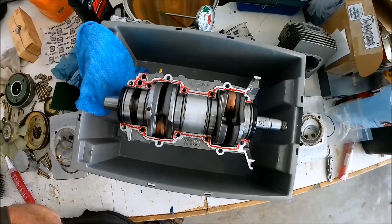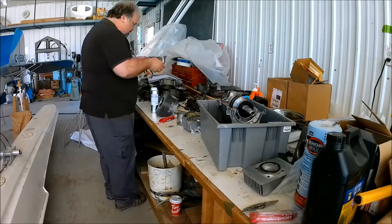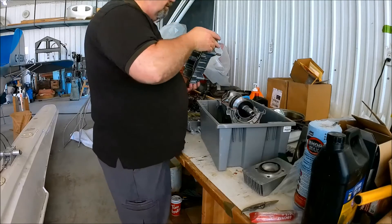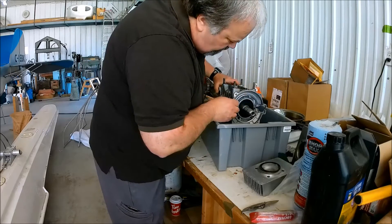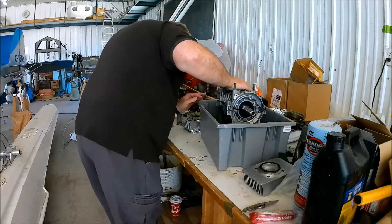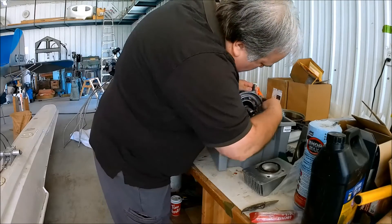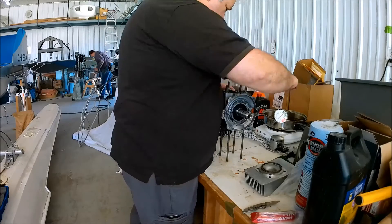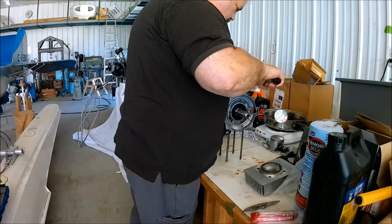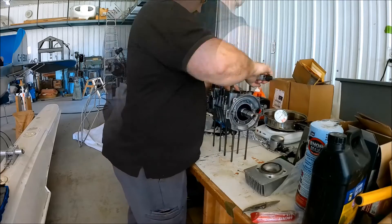There is the view from the top — you can see all the sealant in the areas that the manual says you need to apply it. There's the professional flip, and the other half of the crankcase is now being lowered into place. I've got to tap it down and make sure the engine seals — which have gaps — line up with the oil holes. Those seals have to be oriented correctly so that oil flows. And here I am with the torque wrench, torquing everything down.